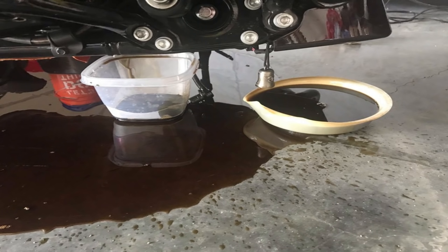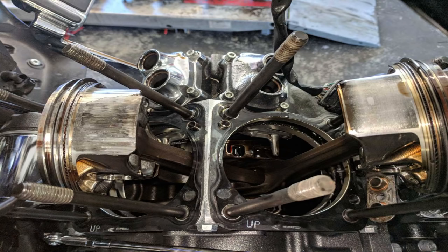The results are pretty nasty. What happens is you start getting oil coming out of places you'd rather keep it in, like in between your gaskets leading to oil leaks. Then you might notice it coming out of your head breathers, which is eventually soaking and contaminating your air cleaner, filling it up with motor oil. And then of course you'll have a loss of oil supply, you'll start noticing maybe some clattering lifters, and then all this ends up in no place good — like accelerated engine wear and eventual engine failure.